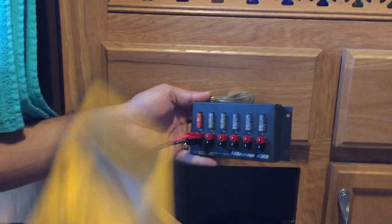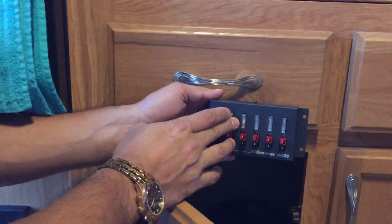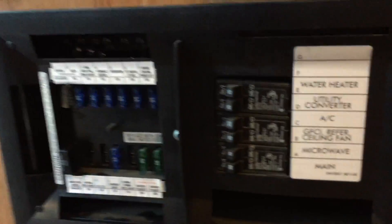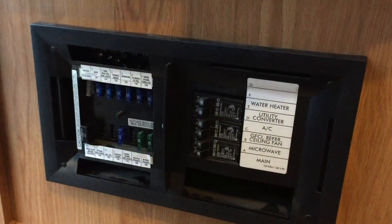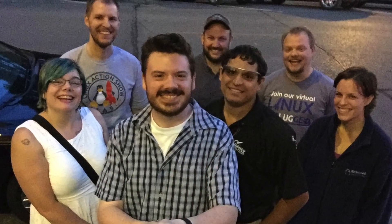You have individual breakers that pop. We've run individual fuses, a master fuse for the connection, and another fuse panel that runs out to the rig runner. Worst case, if we have a short, we'll get a blown fuse — but we're not going to have a fire in the camper. And that's going to be awesome to power the studio gear. Thank you very much, I'll see you soon.